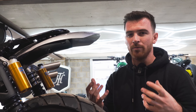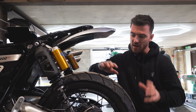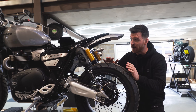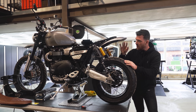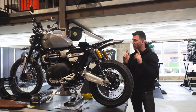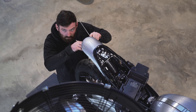We're going to use 8mm stainless rod, bend it up and round, and build a sort of trellis Ducati-style framework for the number plate to sit on. I think that's going to look really cool — we can make this into a really nice art piece. It'll be really strong too, because the last thing we want is a customer having a number plate that snaps off. We need to watch clearance on the wheel to make sure when it's fully compressed we don't have any clearance issues, and we'll address the big gap underneath with a 3D print. Then we've got to move on to the light pods.